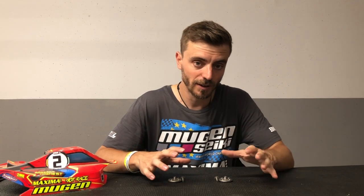When you use 44-13 only front and 42-12 rear, it means underdrive. The car feels easier on steering into the corner and on power — it's easier, more like a front-wheel drive. But it's also quite a bit slower than 42-12 all around, so it's not a combination I prefer. Some drivers like 44-13 front and 42-12 rear just to be more consistent and easier to drive.